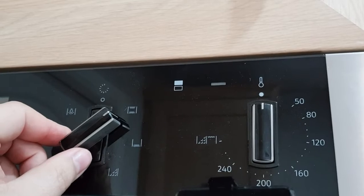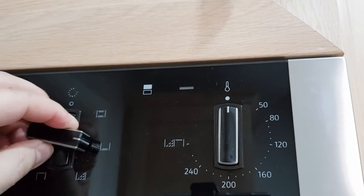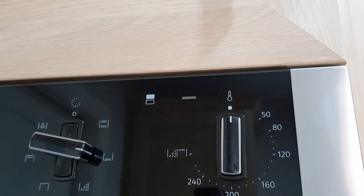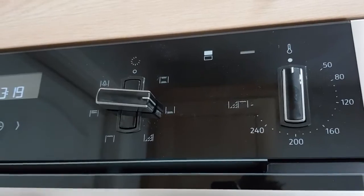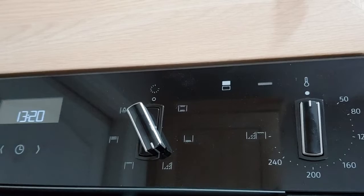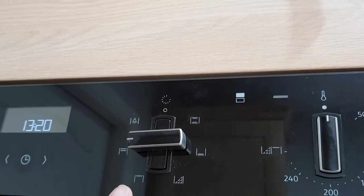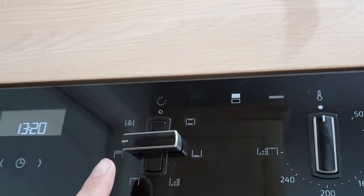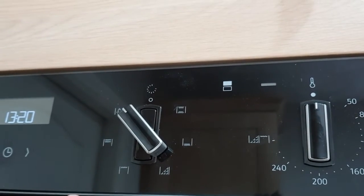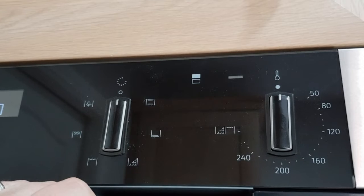The top oven's first option is the conventional oven setting, perfect for baking cakes. Second, you can heat from the bottom of the top oven only — ideal for flans, cheesecakes, or anything needing more bottom heat. Third is the self-cleaning function, heating to the highest temperature to disintegrate and oxidize stuck-on food. Then you have two grilling options: a small grill that heats just the centre — saving energy for two rounds of toast — and a main grill that heats the whole grilling surface. There's also a built-in internal light, and the pop-out buttons keep the clean, minimal look.